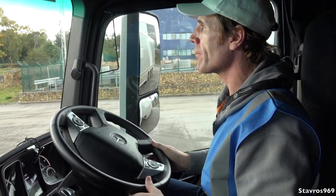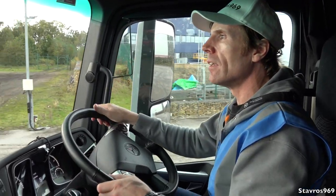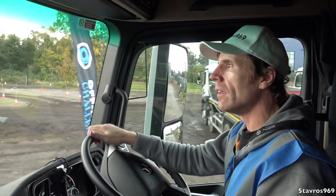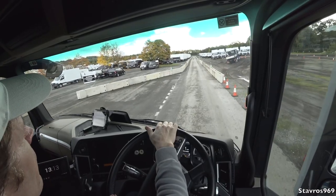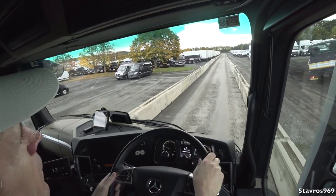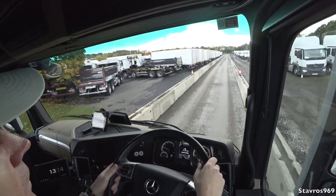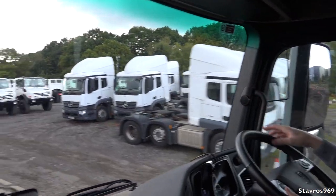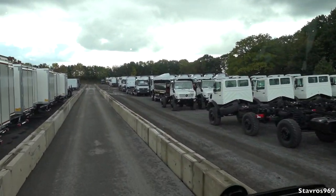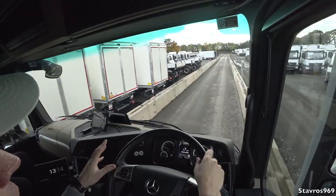What will happen first: you'll get a visual display and an acoustic warning. The truck will then give partial braking up to 50%. If you don't touch the brake pedal, the truck will then give it 100% braking to try and avoid or reduce the consequences of an accident. And we're driving the 2545 Mercedes, so we're back to conventional mirrors on this one. The system has three brake applications in a five-hour period, but because the Actros 5 is brand new, we haven't developed software yet to initiate the braking phase time after time.